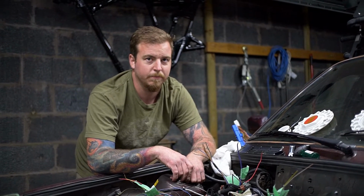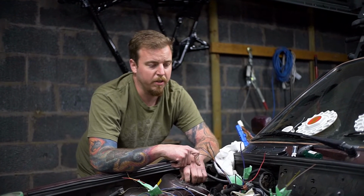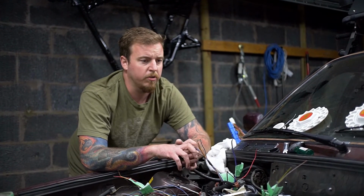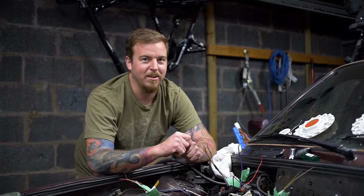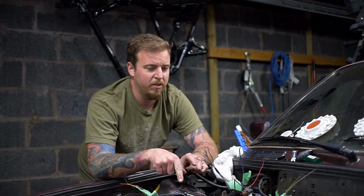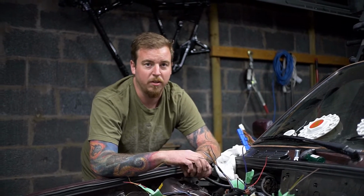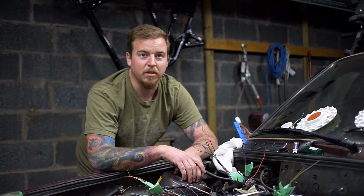Yeah, you're not using coolant temp because you've got an aftermarket gauge. I have an aftermarket gauge. The only thing that we're not going to be able to get to work is the tachometer. There's a company called Wiring Specialties. Got it right this time. They actually make a module where you can put in the input from the SR and program it to put an output for the E30 dash. So we'll be going that route, and we'll have a video on that once we get to that point.